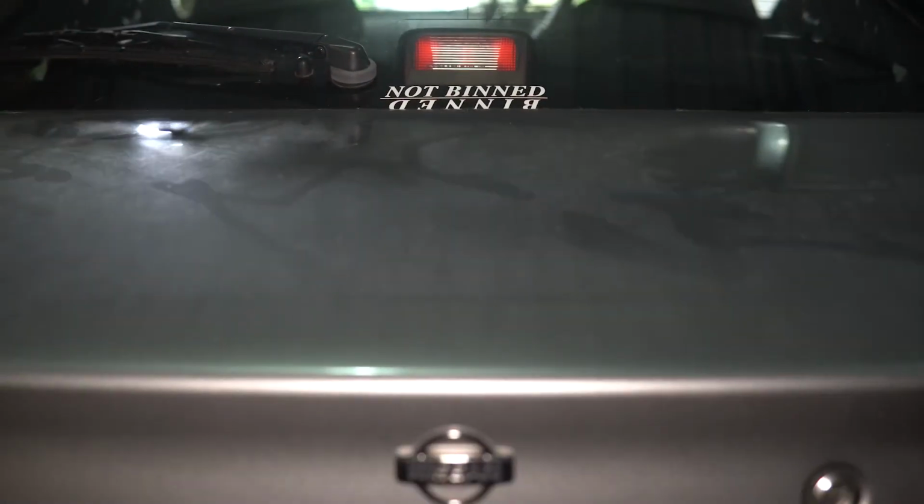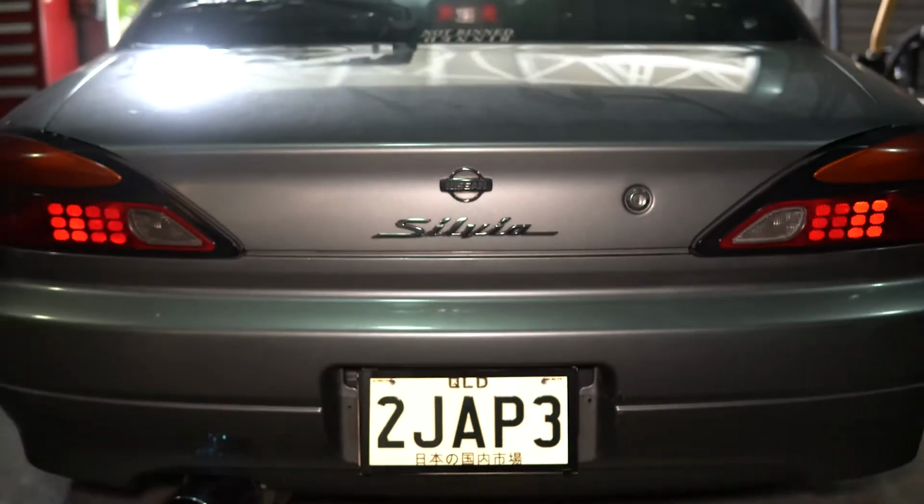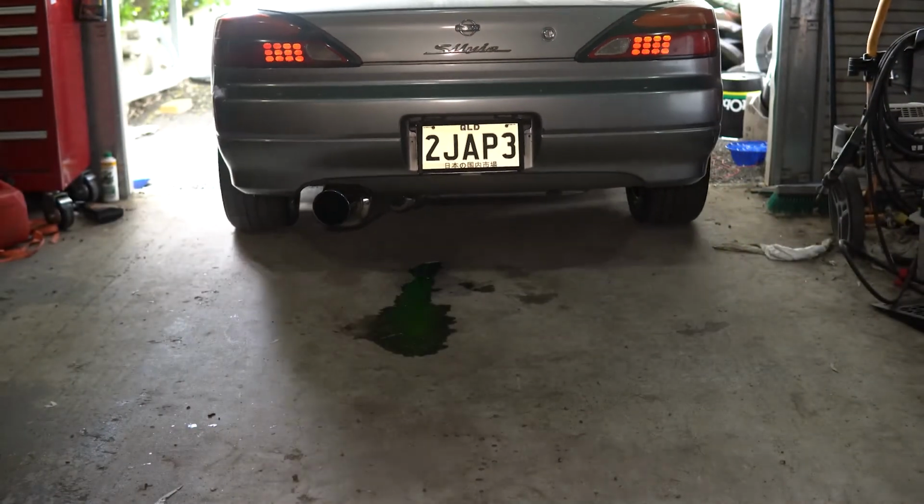In our case, there were no leaks, but there was a little bit of spillage when we topped up the coolant. So we took the car for a drive and the car is sweet. The temperatures didn't get above about 81, 82 degrees and stayed very consistently around that 80, 81 degree mark. So sweet, no leaks, no air bubbles. We did burp the system at the end. So everything's good to go.